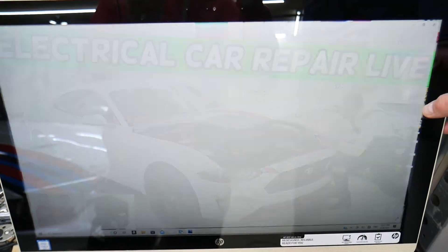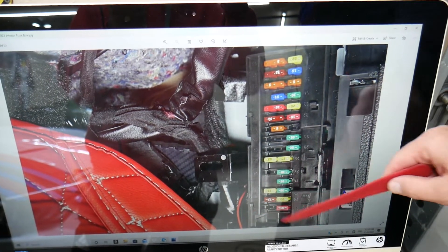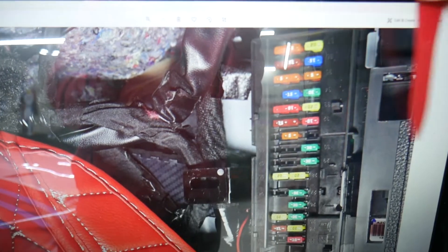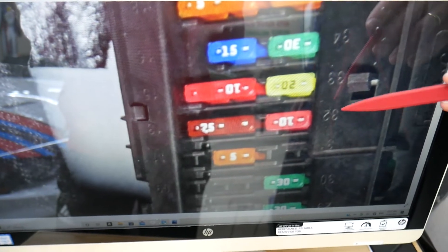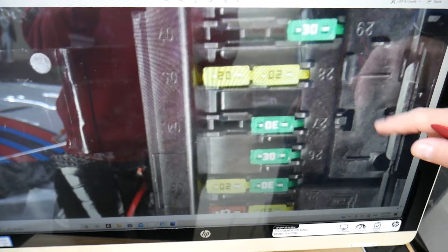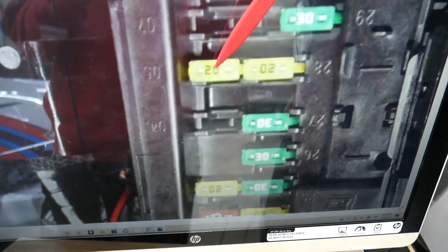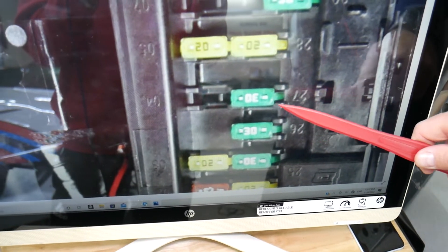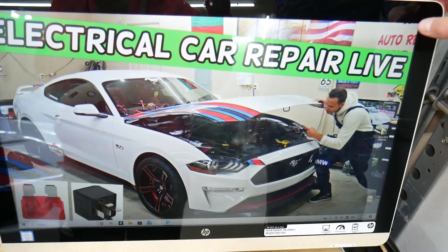We took a picture of the interior of the fuse box so we can zoom in and clearly show you — otherwise it's impossible to get the camera in there. That's the bottom of the fuse box, that's the top, that's the front of the Ford Mustang, and that's towards the back. If we zoom in, you'll notice the fuse numbers are upside down — that's perfectly normal, just ignore that. You'll need to find fuse number 5 and fuse number 27 — those two fuses are for the sound amplifier. Thank you for watching and see you guys next time.